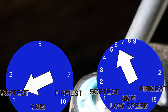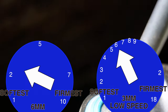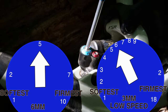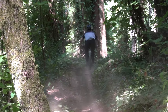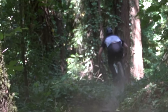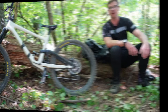We're moving to the six-millimeter key and going to the middle on high-speed compression. I'm getting tired so we're making bigger adjustments this time. I got the shock about 90%, but the problem is I'm not used to riding this bike and I'm completely gassed, so I've got to call it for the day and finish this up at a bike park tomorrow.